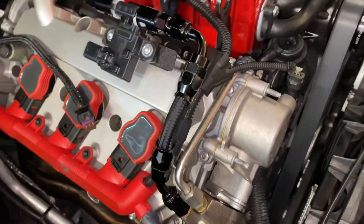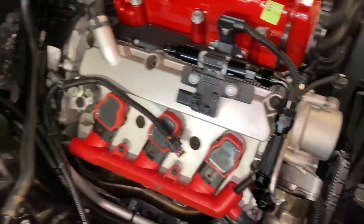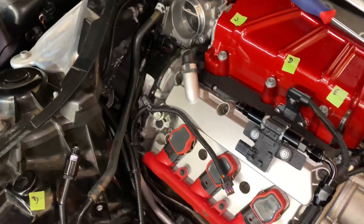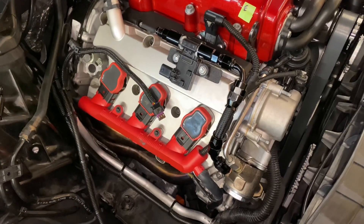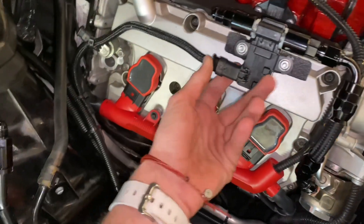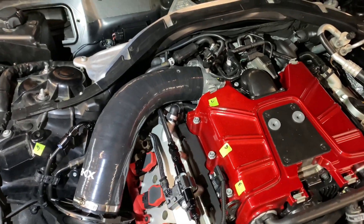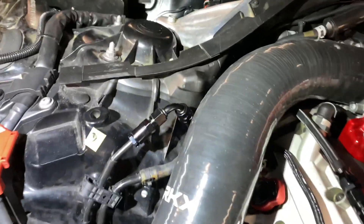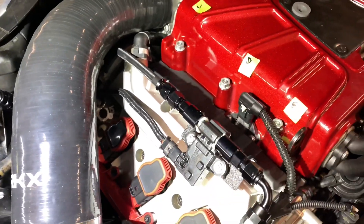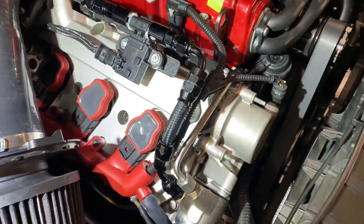The fuel line is in 100%. We had to shorten it a good deal to get it to fit. All that's left is putting the other O2 in and it should crank. This is just a mock-up fit check - make sure everything's fitting. Got the intake tube back on; as you can see there's one AN fitting tucked behind the intake tube over to the sensor, and then a little baby line here.